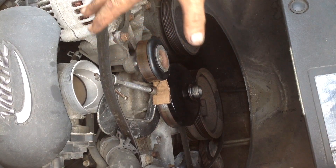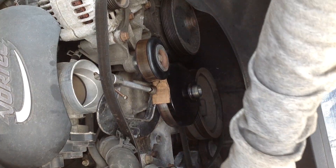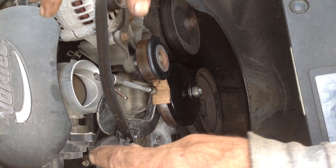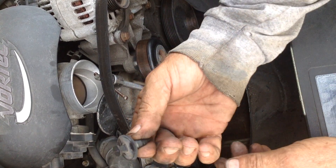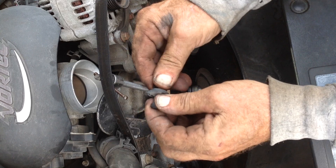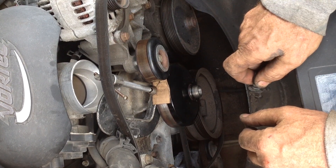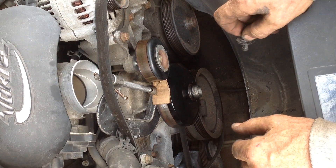There is a fan shroud that goes over all of this. I remove the top radiator hose and move that to the side. Then I remove the top plastic shroud, which is attached with six pop-up clips — you just take a screwdriver and pop up each clip and the whole thing releases. Then you remove the intake boot, and then you have full access to your project.